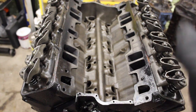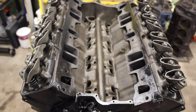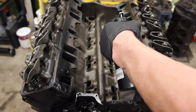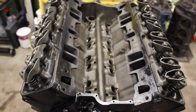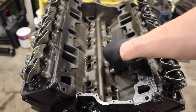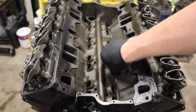One thing that's really important with a flat-tappet lifter is to make sure that everything goes in nice, with a nice little coat of oil on the inside there. Take your assembly oil, do all the bores up, get a nice coat of oil in there. It's so important with a flat-tappet that the lifter is free in the bore. You've got to watch — and if you had your block machined, hopefully you asked them to check that the lifter bores aren't worn out. You also don't want any deposits in there, or after cleaning, any flash rust or anything like that to make the lifter tight in the bore. It should go in real nice — not be loose, but it should be a perfect fit.